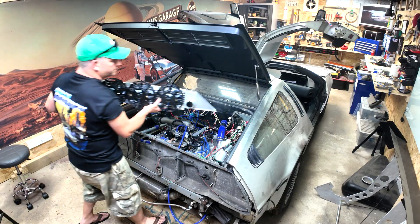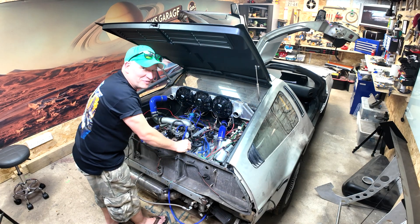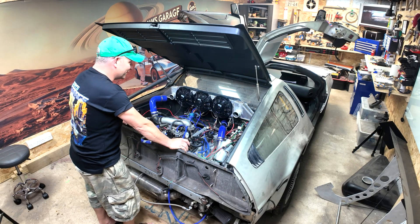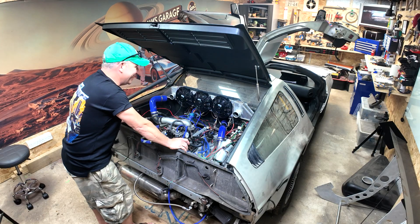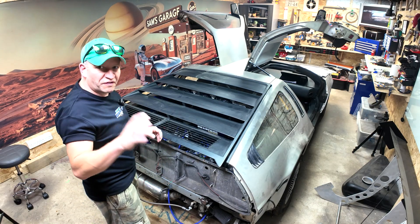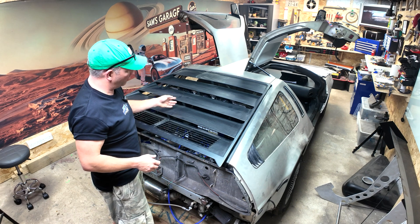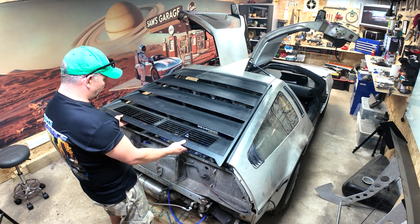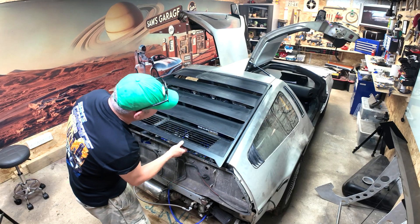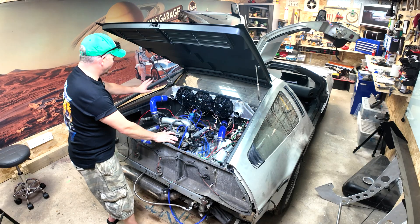Let's get this in the car. I have no idea if I'm going properly over the top but considering it's not a Back to the Future replica, I think it looks pretty cool — it also looks ridiculous. Now we're going to see if it fits inside. The middle fan is interrupting with a spine down the middle of the louvre that reinforces it, so we probably need to go down another 15 to 20 millimetres. We also need to sort out the hoses — one going on here and one going there — and these ones aren't a million miles away from fitting.